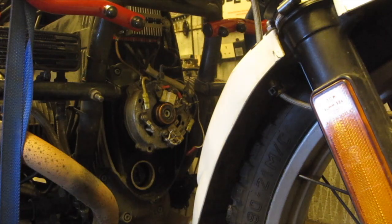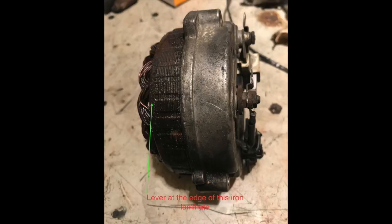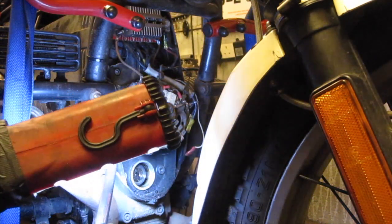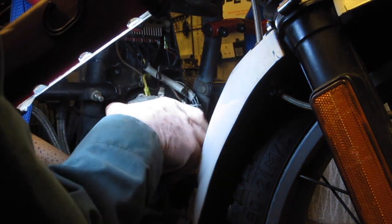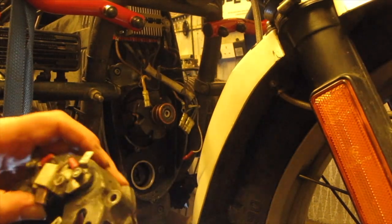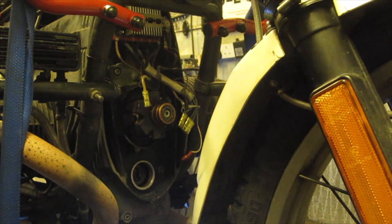I can't get it very easily at the moment — let's try a pry bar. So yeah, just carefully, maybe a little bit stuck. There we go, that's coming. So that can just be lifted off as one unit. The alternator brushes will pop down there under spring pressure — so they're the alternator brushes. So that can be stashed away carefully. That leaves the rotor exposed.